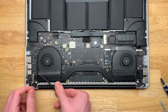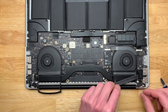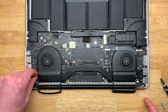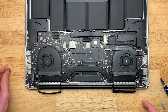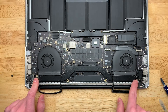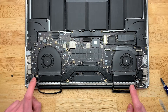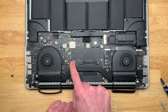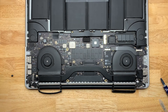To remove the heat sink, just take these rubber seals — these rubber boots — and gently peel them away. Next you have this rubber cover; remove that. Then there is a screw here and a screw down there, which I believe are both T5 Torx. They are not the same size and don't even have the same head, so do not mix them up. Then we have four screws for the GPU and four for the CPU, and the whole heat sink should just pop right off.